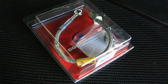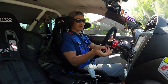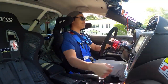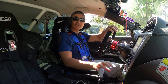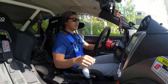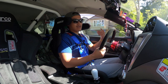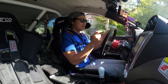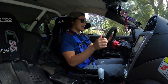As an option, I did not get axles and hubs — you can stay five-by-100. The reason I didn't do it was because the one I bought off eBay didn't come with axles and hubs. If I want to do it later, it's not very hard — I think it'll cost maybe $1,500 to find the parts — and to add the DCCD I just need to connect the two wires that are off to the side. Besides that, it's pretty simple and basic stuff to get an STI six-speed swap done. There aren't many parts; it just seems more labor-intensive because it definitely is — you've got to drop the trans out and do your clutch, and if you're not familiar with that it can be a hard thing to do. Most people ask me what's needed and they're surprised at how short and basic the list is — they thought more parts were going to be needed.